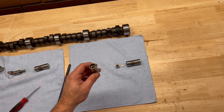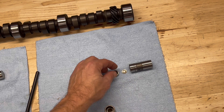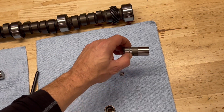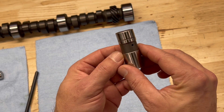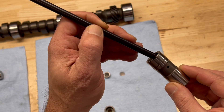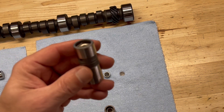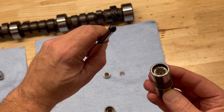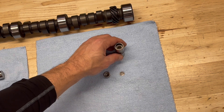If you look at the lifter I took apart: you have the lifter body, an oil metering plate, and the push rod cup. Oil comes in through the feed hole, fills the empty chamber inside, and is then fed up through the push rod — you can see the hole right there — up to the upper rocker arm assembly, and that's how it gets oiled. The hydraulic lifter works the same way: the oil feed hole fills the chamber, and that fluid transfers up to the rocker arm assembly.